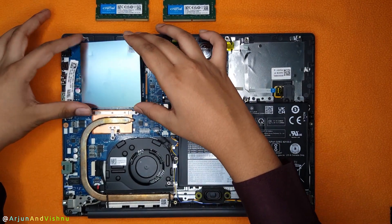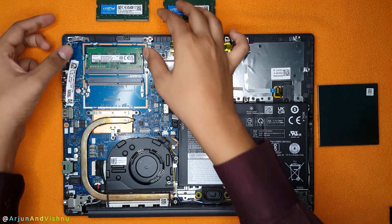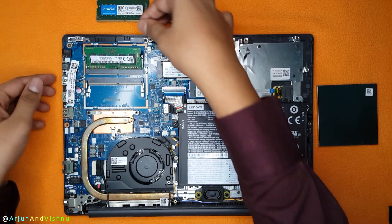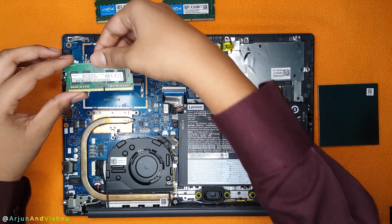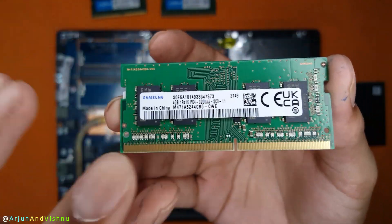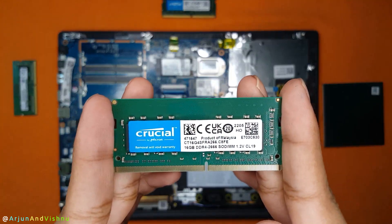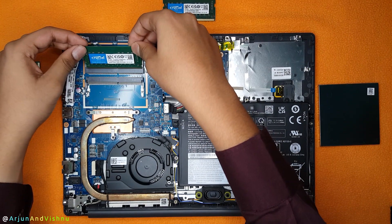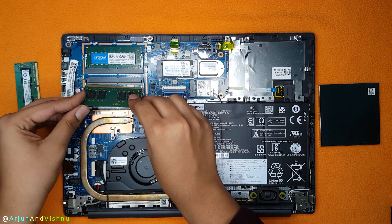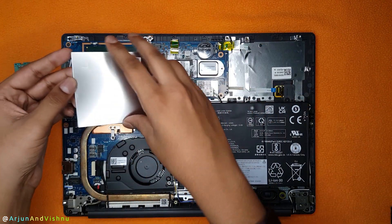This Lenovo laptop comes with only 4GB of RAM. While many applications get along with that alright, it is useful to have at least another 8GB to have headroom for memory-intensive applications. The supported RAM is DDR4 2400 MHz — even if 3200 MHz RAM is installed, it will clock down and work fine. To add RAM, the metal shield needs to be removed; it comes off fairly easily. There are two DIMM slots. Slide the new RAM in and push it down to lock it. I decided to test its maximum capacity, installing two 16GB sticks — 32GB total — to enable dual-channel for faster memory bandwidth.